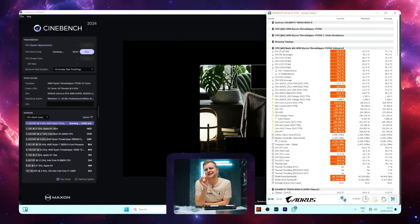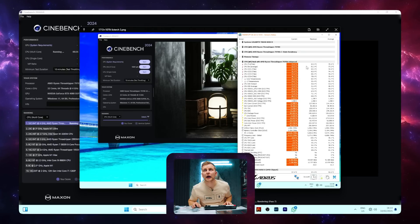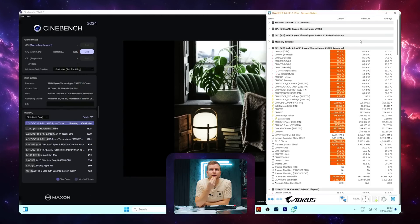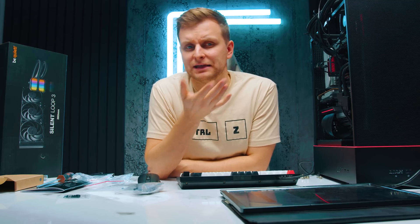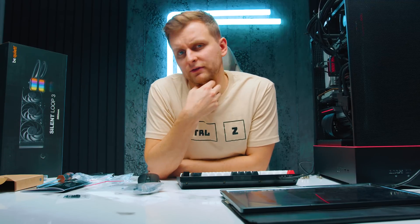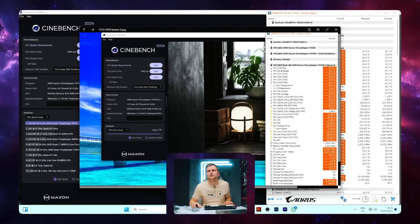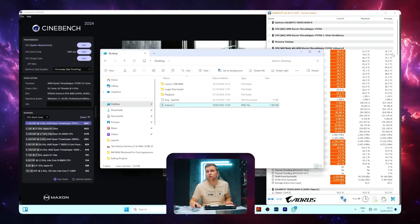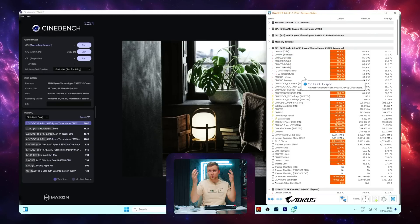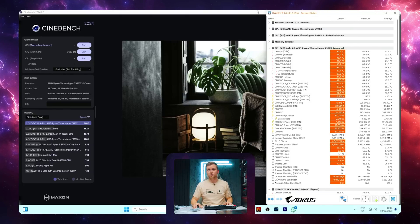With about 50 seconds to go, the temperature is 81.8 — no wait, 83.9 degrees. So we are a lot lower than expected. Let's see if we finish with higher points as well. By the way, this is a Threadripper 7970X, 32-core, 64-thread, pulling 350 watts. Final score: 3,687 points. In terms of points, we didn't get much difference — just a little bit higher — but temperatures are where things are very different. This was 81.8 versus the previous 83.9 degrees, so about two degrees lower, and I'd say this is at a disadvantage because the room is hotter and we're pumping more hot air in.